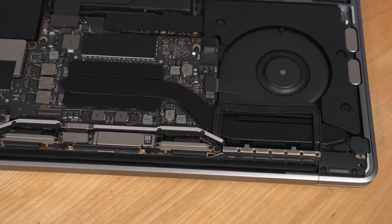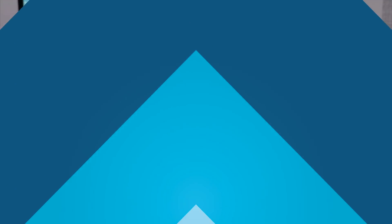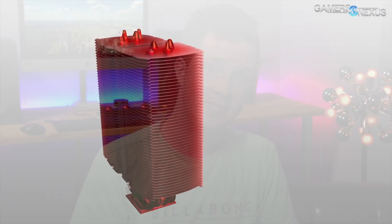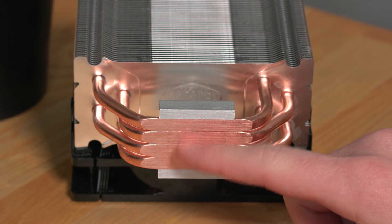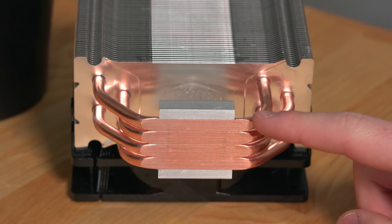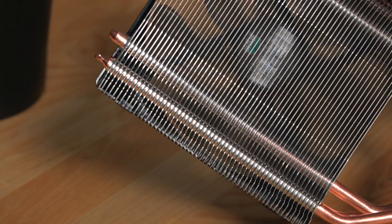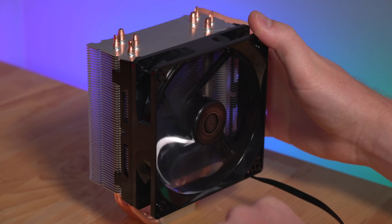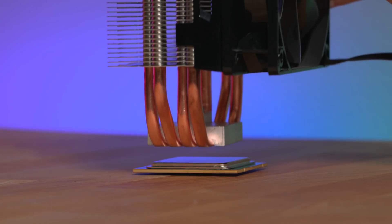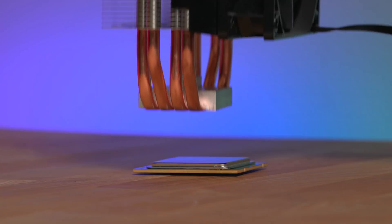Now I mentioned that I obviously can't add a fan or a heat pipe to my laptop, but I might be able to do something to mitigate throttling. Cooling a CPU is actually a pretty simple concept — Gamers Nexus has an excellent video on it. The basic idea is that the CPU cooler has a copper block and copper heat pipes that draw heat away from the CPU, and that heat is spread out on a fin array radiator where it's exhausted by a fan. Thermal paste is used to eliminate air bubbles in that tiny gap between the CPU and the cooler, to effectively transfer heat between the two.